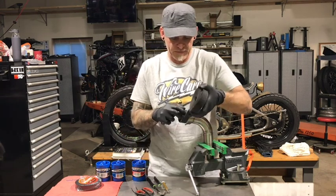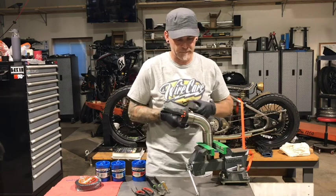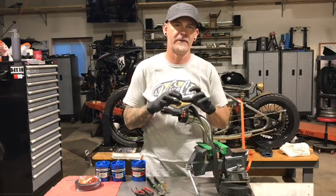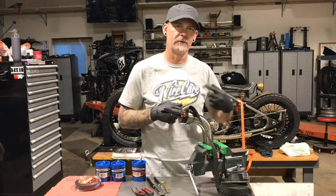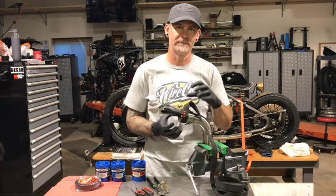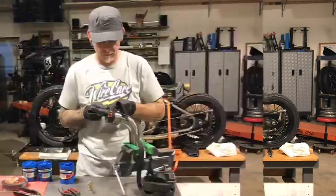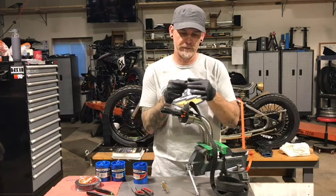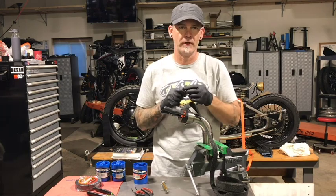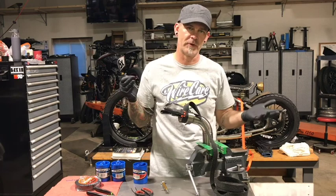You want to get it tight. Start by getting that section right there, then set a clamp on it to hold it. To do this well, you want to get the safety wire into this area and get it on there tight so you can pull tight when you start wrapping. The key is to safety wire this starting area with the clamp tight tool and the safety wire so it's very snug. I took a big long piece, put a bend at the halfway point, and stick those wires through it, then use the clamp tight tool around the other side. That way as you start to wrap it'll actually cover most of the safety wire so you don't even see it — which looks clean.